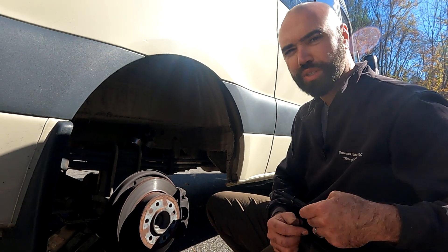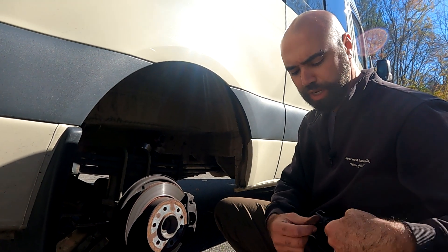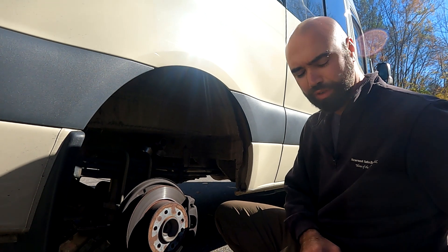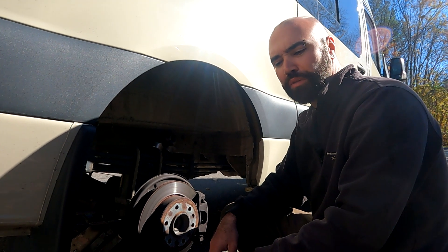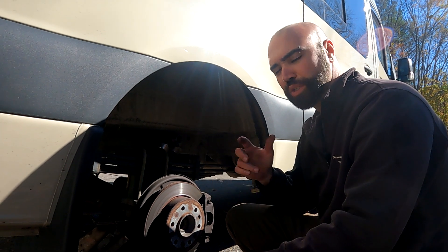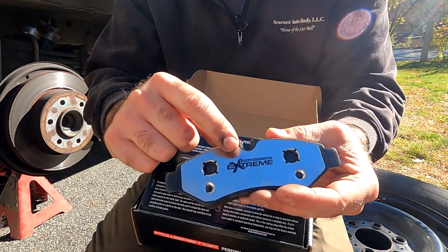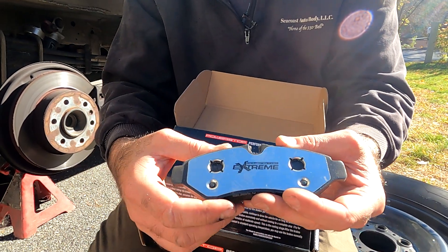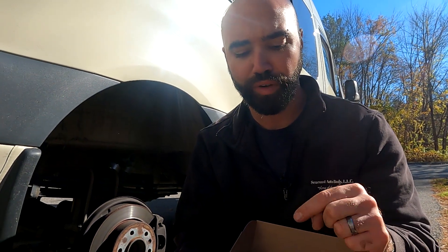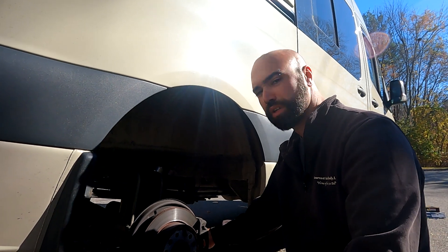One thing I'm not going to be able to show on this side is how to remove the wear indicator, because I thought it was on both sides but it turns out that piece is only on the driver's side rear brake pad. I wouldn't have done a good job showing you how to remove it anyway because I broke ours when I did it — I super glued it back together and so far it seems to be working. What I tried was gently prying it out with a screwdriver in the gap between the pad and the sensor, but that cracked the plastic. Knowing what I know now, I'd try prying more gently from both sides back and forth.